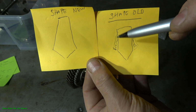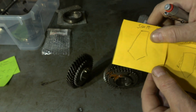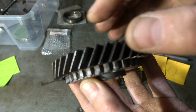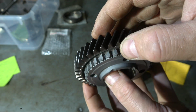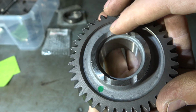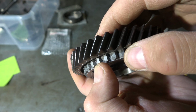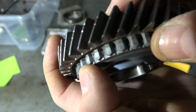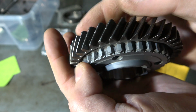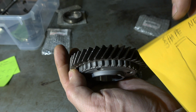And that old part is slippery because one area is gone, and in the new parts, all the teeth are okay. And now when we look at these teeth very carefully, like in this new one, we can see that there is really this movement, this shape, it is different. They look different, and everything is almost similar, but this is the area that is worn out, and that's why this old gear is slippery. And now when we look in here, we can see maybe this difference.